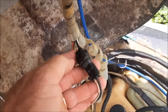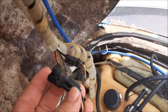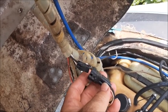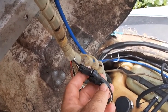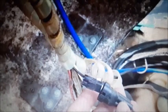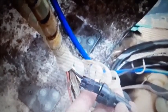The other plug is going to be a black and white plug — this is the one that shuts down the CDI unit and the spark. There's a button just under the collar; if you push that button down and pull, this will separate. Effectively, what you just did is bypass the stop button. Now go ahead and try to start your jet ski, and if it starts and runs fine when it's disconnected, then the probability is that you have a bad kill switch. If it does start and you plug this back in and it immediately stops, then you know you've found your problem. Remember: if you disconnect this plug and try to run it in the lake, the stop switch will no longer work. Your alternative way to stop the jet ski would be to pull the choke out or turn the fuel selector switch off so it will run itself out of gas.